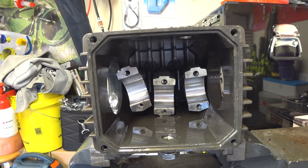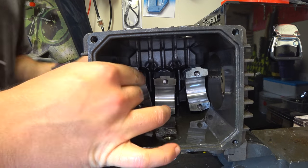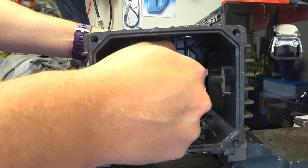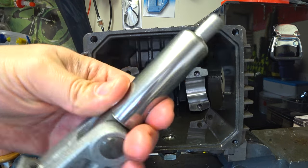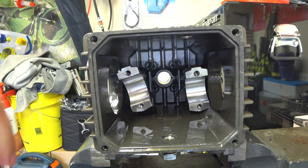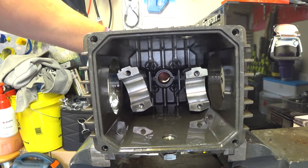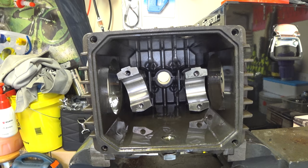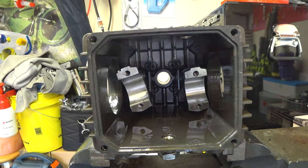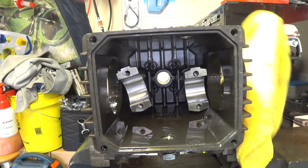Let's put the crankshaft down somewhere safe. Now these should - I would say - slide straight out. Let's go for the middle one. There's your rod. And there is - I don't know if you can see right where my finger is at the back - there is a bushing in there which is replaceable. They're not that expensive, they're only about six, seven quid. Have a look at the bushing. If you've got motorcycle knowledge it would look very similar to a fork bush.